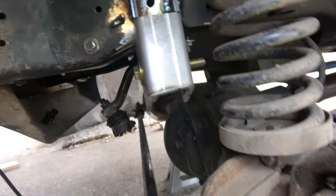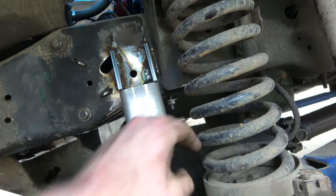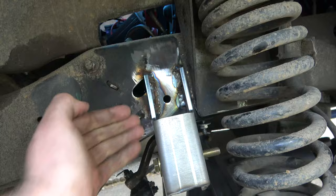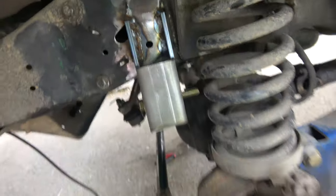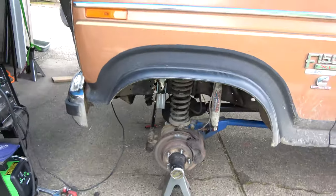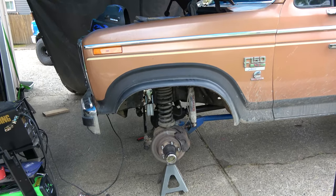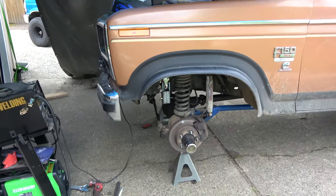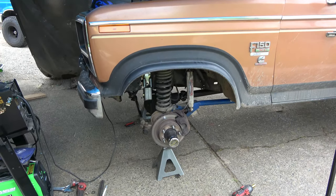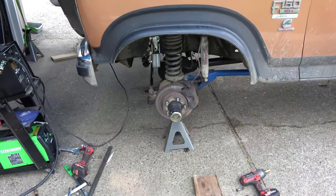We cut a little bit off so we have plenty of room and nothing's going to crash anymore, which I'm really excited about. We still have to weld the bottom and a little more on the sides, but we can pretty much make the bar now. Once we finish welding, let it cool off, paint it, and test it out to make sure it doesn't break off the frame. I'm going to trim that bolt down too since the hardware store didn't have the right length. Really interested to see how much tighter the steering is going to be instead of feeling like it's made of yarn — even with my new steering box and Borgeson steering shaft, it's still been spongy because of that track bar. Done with it.